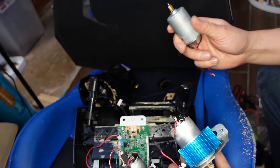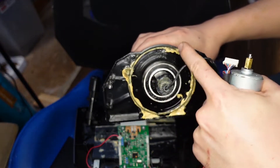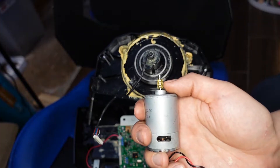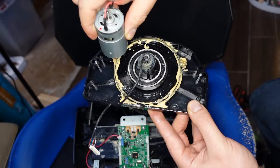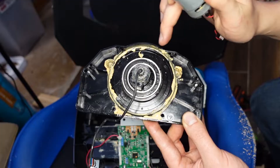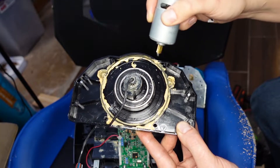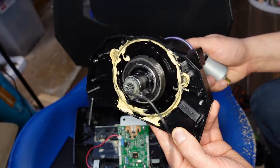So here's the main problem. These are the brass gears — that's what contacts the whole ring. This is what they talk about when they mean the gears are shearing. These are the gears that will shear. They tend not to because the brass gears are angled or chamfered — they go in and spin and turn. Generally people say these break, but I've never seen one. The internet says otherwise — your mileage may vary. But if you do wind up having broken teeth, that means somewhere in the rotation it will skip, and it'll be a specific spot in your rotation you can identify.